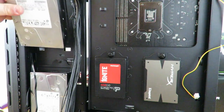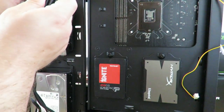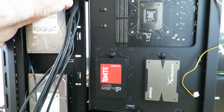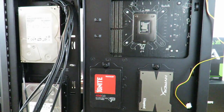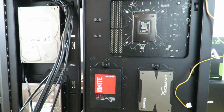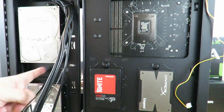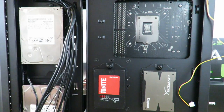All right, so now we'll just slide it right here and just move these cables out of the way. And again, we can just use our fingers for this to screw it in. The way it's supposed to be on this case is SATA data and power come up here and here as well, but that makes things a lot more difficult for cabling. So that's why this one is upside down, so that everything is right here. And I explained it more in the review for the Cougar Panzer case. We're gonna go ahead and install